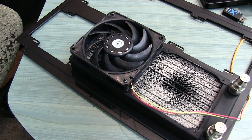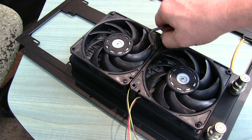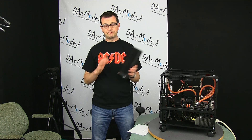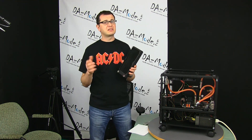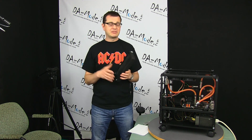I mounted fans back on the radiator, trying not to disturb all the dust, and started running tests. To be consistent with my previous test, I decided to check two fan speeds: 1100 RPM and 2000 RPM. I started with 1100 RPM first in order to preserve the dust in the system, because I was expecting some dust might get blown out when I sped up the fans.